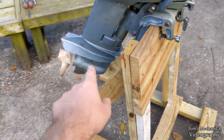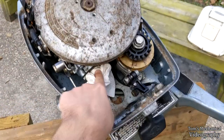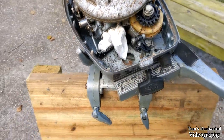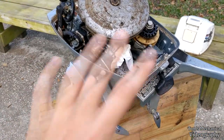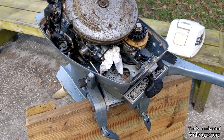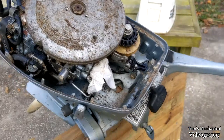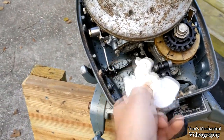I'm going to Dremel that out and pack it with JB Weld since I don't have a TIG welder. Over at the carburetor, there was a tree ant nest inside of it. I totally disassembled the carburetor and it is in exceptional shape — beautiful looking. I was even able to reuse all the gaskets. The ants weren't into the fuel bowl or anything. They were just in the air cleaner silencer thing and also in the intake.